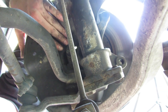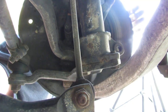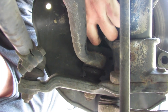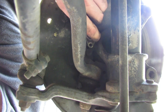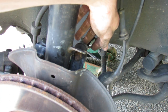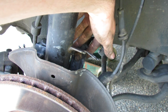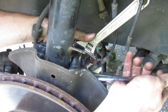Looking at the backside of the brake rotor: up here is where we removed the brake caliper bracket, and here is the wheel speed sensor — this is a 5 millimeter Allen. I already popped it loose so it's just finger tight; spin it out and wiggle the sensor free. The last thing to remove is the upper nut that holds the top end of the sway bar end link — this is a 17 millimeter. We need another wrench to hold the shaft of the end link; the shaft appears to be 16 or 17 millimeter, but I opted for an adjustable wrench.